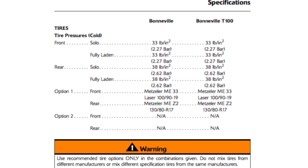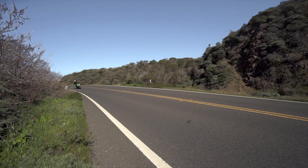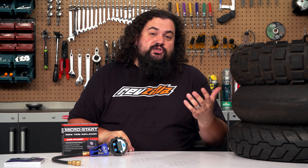It's a great departure point. However, I would say don't feel like you need to be locked into those pressures. Again, think of them as a departure point. Experiment a little bit. You can always over-inflate a little or under-inflate and see what kind of performance your motorcycle yields. Now, we'll move on to our next scenario, and that's somebody taking a street bike to the track.